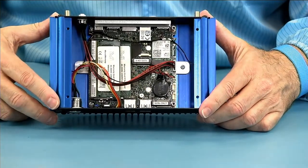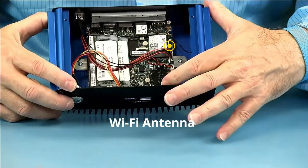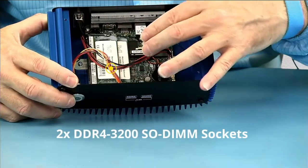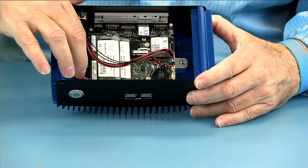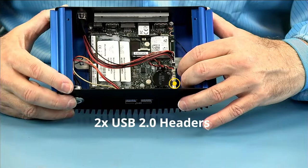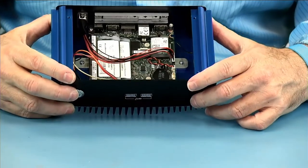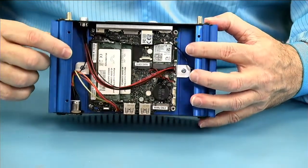This will be very familiar to those who have used Tiger Canyon. You can see we have our WiFi antenna, our place for our DIMM, our M.2 2242 slot, optional IO devices, and our two DDR4 DIMM sockets. We have our front panel header plugged into the front power switch, and our RS-232 serial. Additionally there are two USB 2.0 ports for additional IO to the IO bracket. You can see our battery here, which is easily replaceable should it expire, and the antenna connections plugging into the radio.